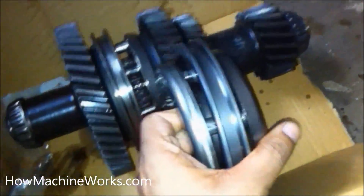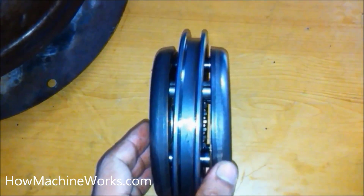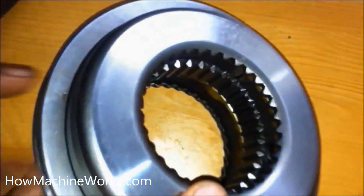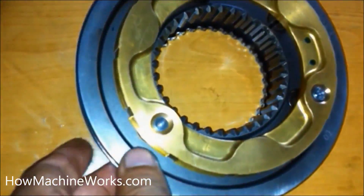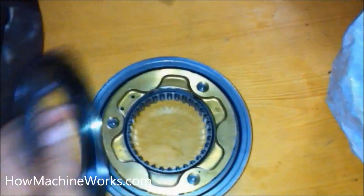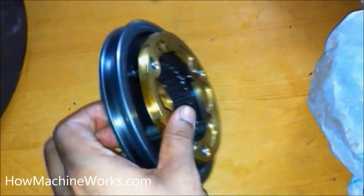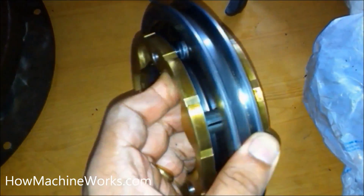That's how the fork actually looks. You can see the synchronizer now. Let's have a closer look at the synchronizer and see how it exactly works. On the synchronizer you can see the gate towards where the fork is getting engaged. Inside the synchronizer we have gear teeth which are getting engaged towards each of the gears. It has two gaps on the sides. That's the unit — it can move and sync towards a particular gear which carries the drive.